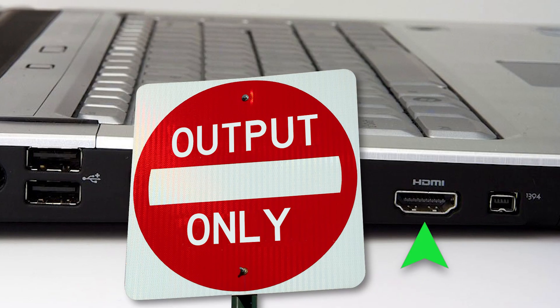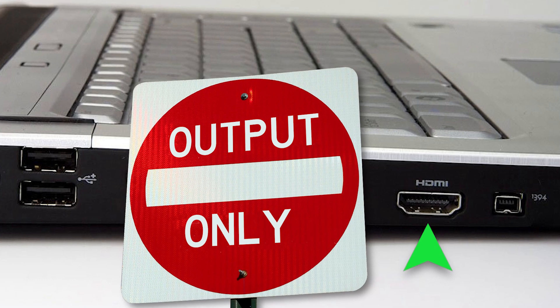When looking at the pro-level camera you already own, you might be thinking: why can't I just connect the HDMI or USB from my camera directly into my computer for Zoom calls or OBS streaming? Most computers do not come with a built-in capture card, so that HDMI port can only output an HDMI signal, not take it in. And while USB is capable of taking incoming data, most cameras will need a hardware or software solution to convert your camera's video into a streamable signal.